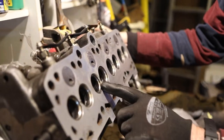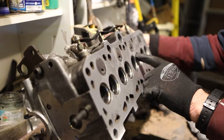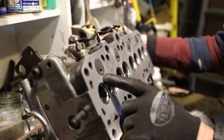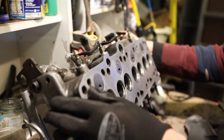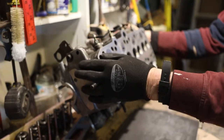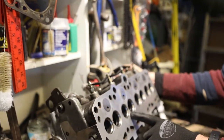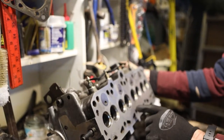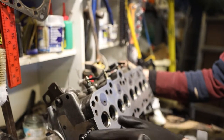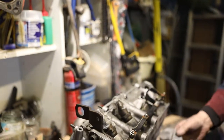It's just here where I think these are raised, you see, where it's cracked. I think it's slightly raised. Oh, I see, it's like lifting off a bit. Might be. Not much you can do about that, is there? Not a lot, no. It will be inside the gasket. The gasket goes around there. Just do it in the middle then. Is it flat in the middle? Maybe use a straight edge that way.